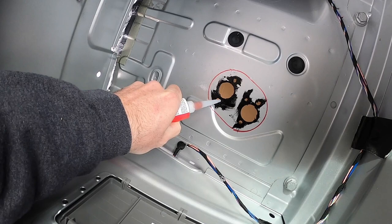One last look from this side: we have our three points of entry for the diesel heater — the small fuel line, the intake for air to get combusted into heat, and the exhaust. Four 10mm bolts secure the SBAR to the floor, surrounded in high-temperature red silicone from JB Weld. The intake line runs in a downward direction the entire way — if it doesn't, you need to drill holes to prevent condensation buildup. The exhaust runs into the muffler all the way down to the sliding door.